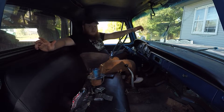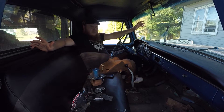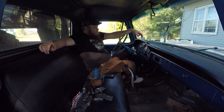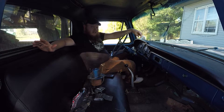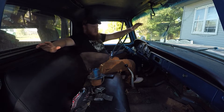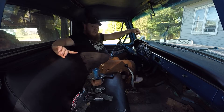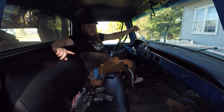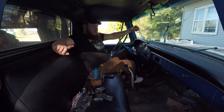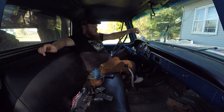So you're probably wanting to know what the build plans are for this truck. Initially it's going to stay pretty well stock. Since the 240's got compression issues on cylinders one, two, three, and four — five and six are low but I'm not as worried about those — I'm going to go ahead and yank the head off, replace the head gasket, replace the intake and exhaust manifold gaskets, and run a new exhaust system. LMC Truck has an exhaust system for it for like $150, so I'm going to go ahead and drop the cash on that.